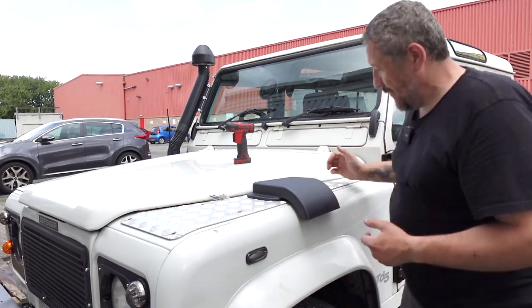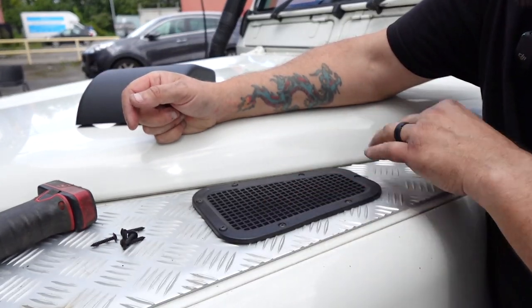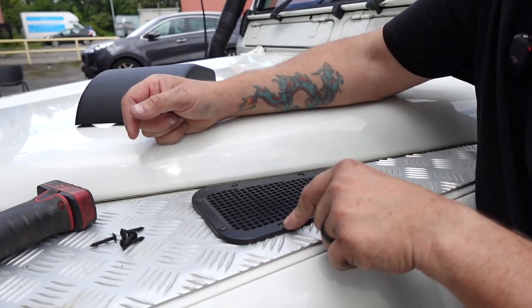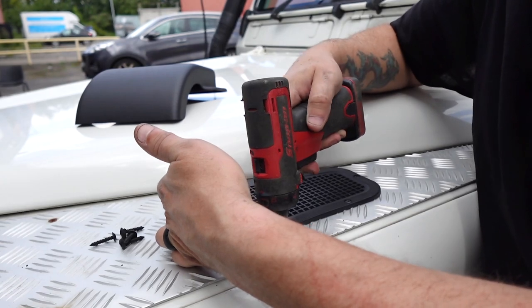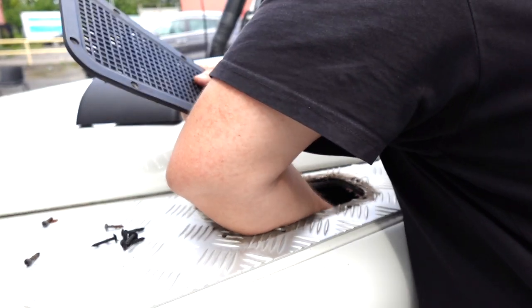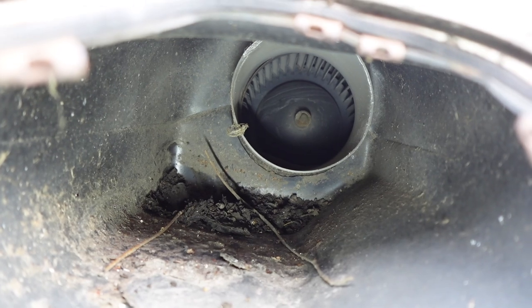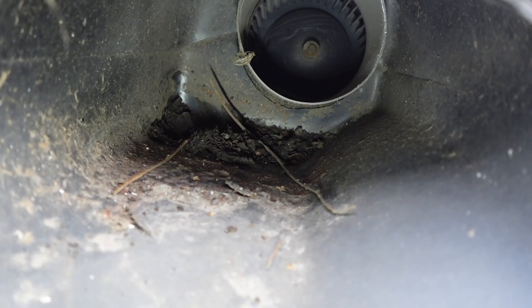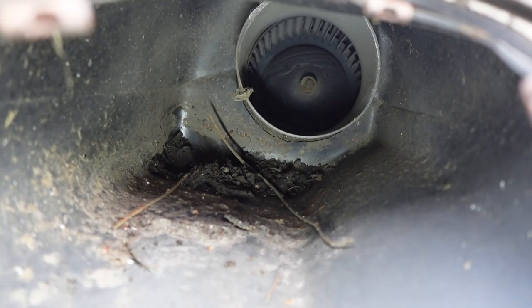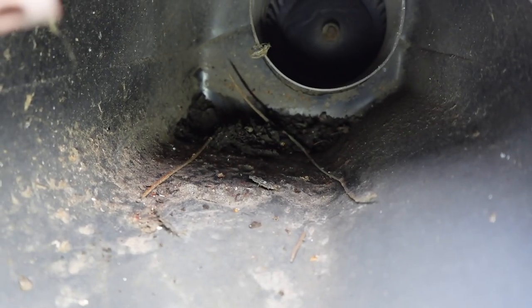I think they really add a nice look to the vehicle. On a lot of vehicles with checker plate fitted, whoever refitted this cover over the checker plate hasn't replaced the existing screws with longer ones, so it's only held on by a couple of threads — it doesn't take much to undo it. It's a good idea straight away to add those extra long screws. Let's have a look and see if this bung's blocked up — yep. You can see all the muck in there; that is the air intake for your heater, and all that muck is covering up the drain hole. If it rains really hard, this is going to fill up and overflow into your heater matrix without question — you can see tide marks in there as well. I'm going to clear that now while we've got room.